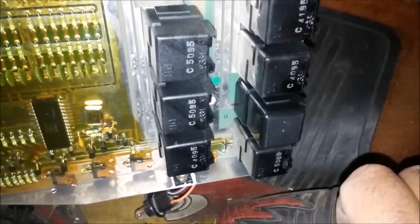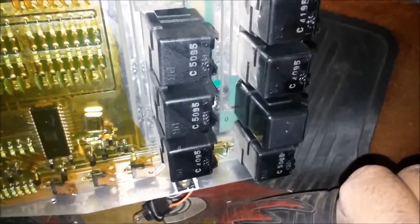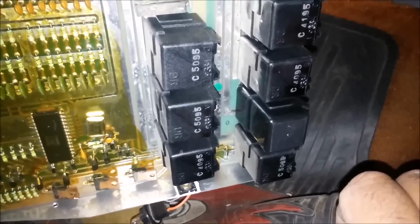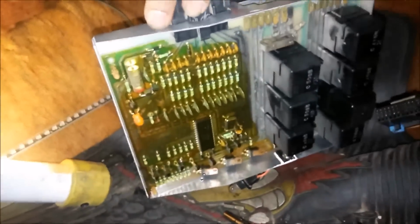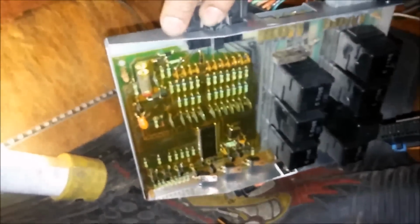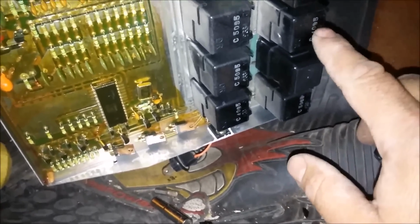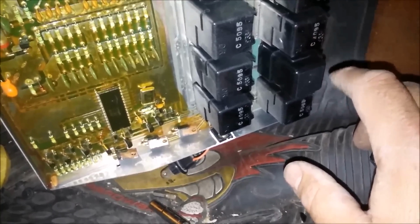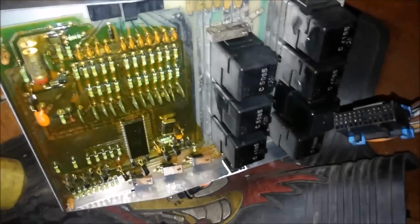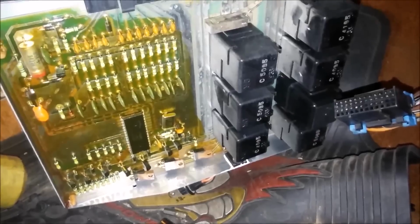We got the flashers on both right, left side. We did the blinkers, left, right side, and we also did the hazards. And everything came on nice and easy. Now, the problem that I noticed when we first started out is that the left side was only happening, which I believe, I might be mistaken, this might be the left blinker. And it was working fine, but the way we figured out that was the problem is I started flicking on the housing, and magically my right blinker would start. So that's an indication that it may have been a relay.